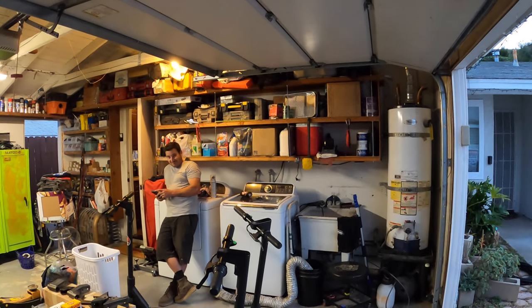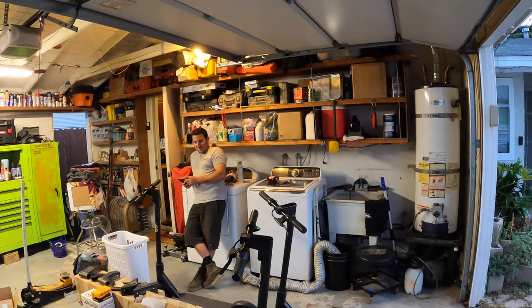Hopefully in the next couple of days I can get the shocks in and everything else mocked up - the hubs and everything. I never showed you guys these hubs - they are awesome and also pretty freaking heavy. I still have those to put in and mock up. I'll show you how you set the rear ends up too, because it's very crucial - they give you this crush washer that you have to mill down on each end of the housing, otherwise you could damage the bearings.